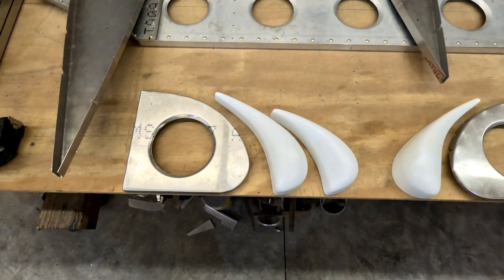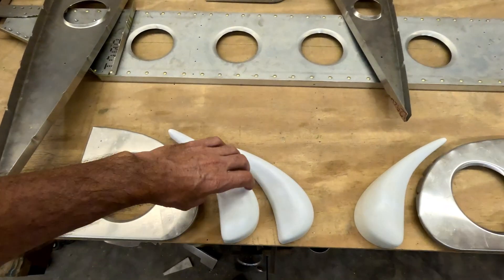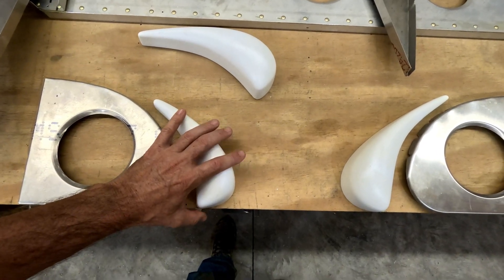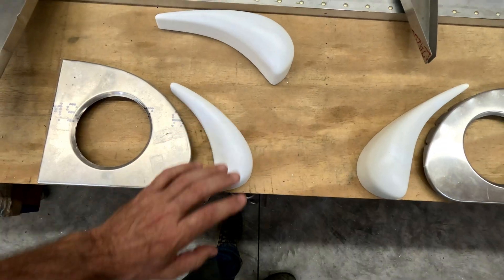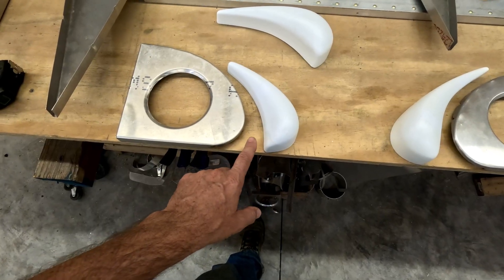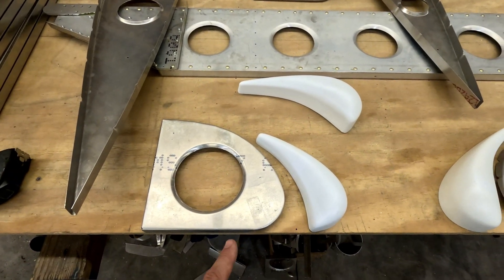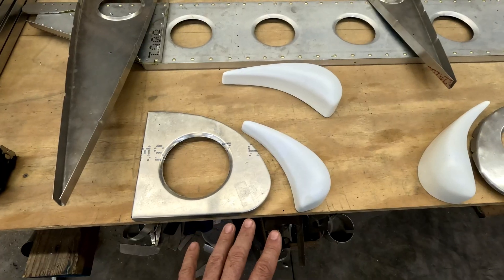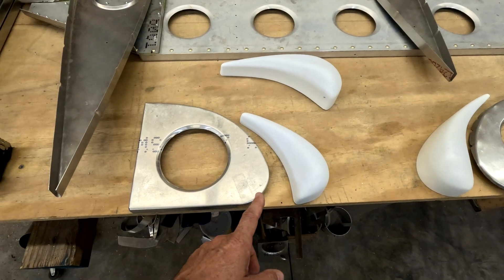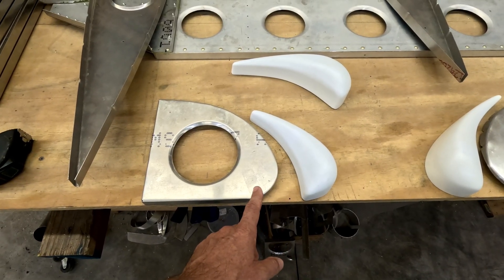There's a lot of difference. I've been thinking about this a lot for my 701 platform and what it's going to be capable of. My super 701 has been an absolute beast and I know it works really well with this setup down in the 15 to 20 mile per hour range. However, with the single seat 701 I'm building, my plan is to lighten this plane at least 100 pounds — my goal is close to 200 pounds. If I'm able to do that, I should be able to slow this thing down quite a bit more, even below 15 miles per hour.